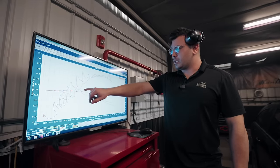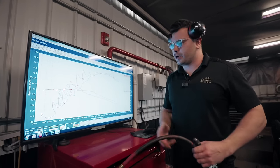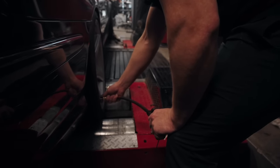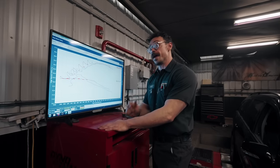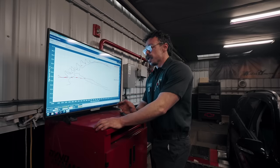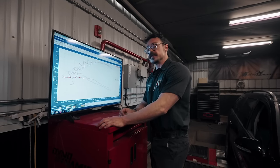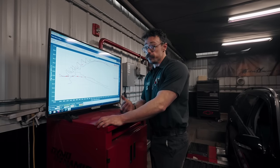This thing's making a ton of torque and as you can see, we've got a lot of tire slip on the dyno. We're going to drop the air pressure in the tires a little bit and see if we can get it to hook up better. While Donnie gets those tire pressures set, let me go over what's happened in the last few weeks since we found the intercooler issue — the intercooler was dead when we got in there, and we also found some problematic hoses that could have been rubbing on the belt causing a future issue.